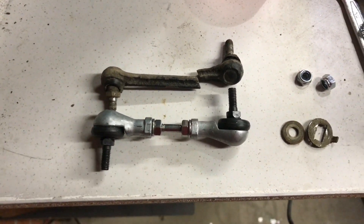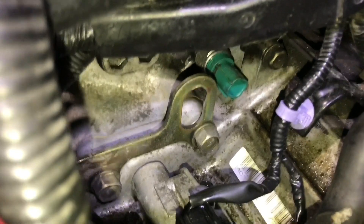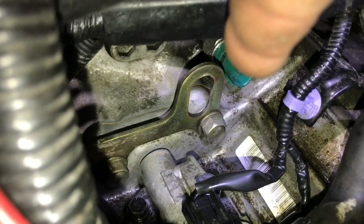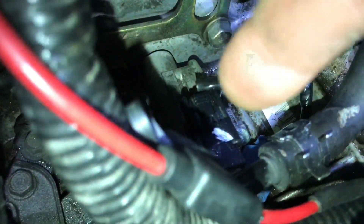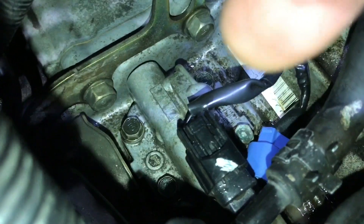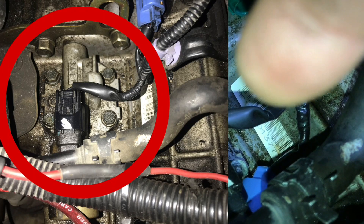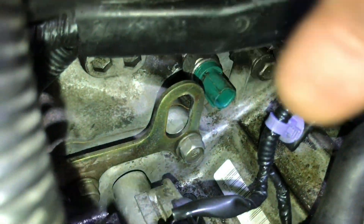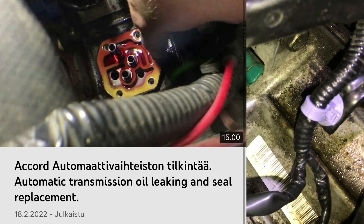That still needs to be fitted in the car. Here's one more mystery. In some episode I mentioned that sensor had been replaced because it was letting oil through — it was clearly leaking there. But the seeping has continued. The seals under the solenoid were also replaced, and yet gearbox oil has still been collecting in that recess. It had been wet there; it's already been cleaned now. But I just can't figure out where it's coming from.